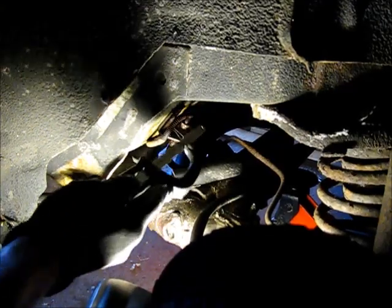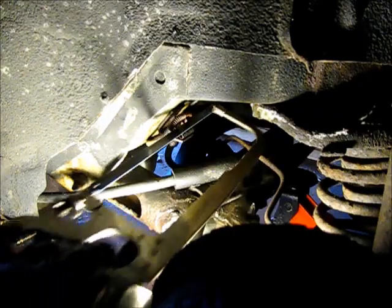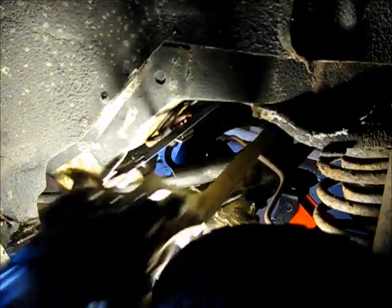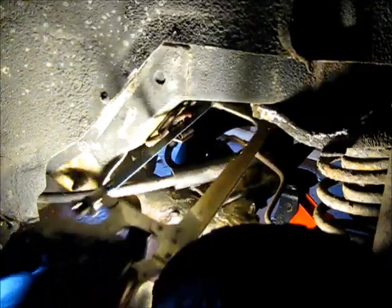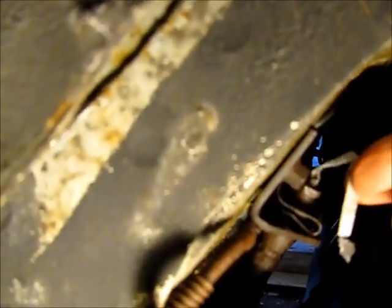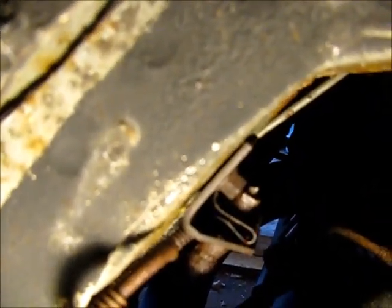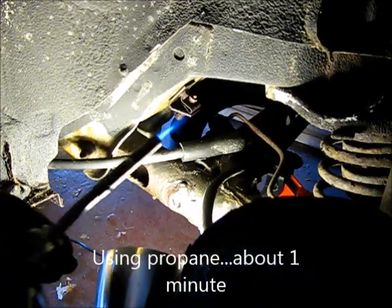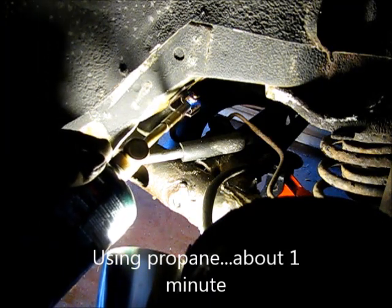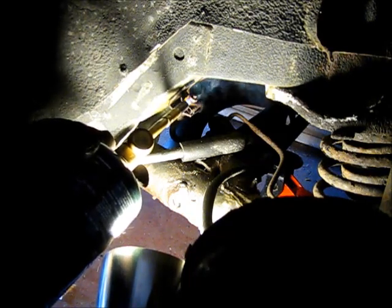This line is seized — not only onto the brake line but onto the hose. We're going to take care of that. In preparation for heating this nut out, I put in a little paper towel to wick out some of the brake fluid that's still in the line before heating it up. So in order to get this fitting out, I'm going to heat it up and reuse the brake hose. Have a fire extinguisher handy whenever you're doing this.